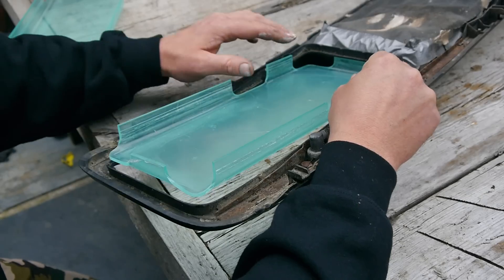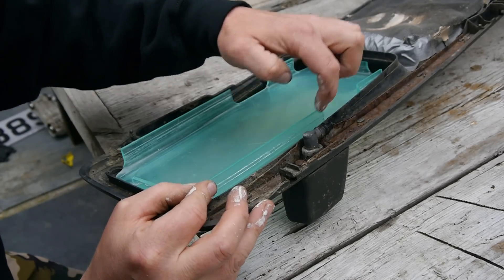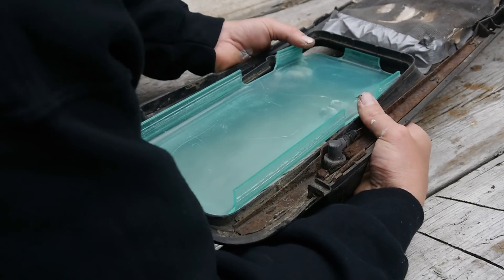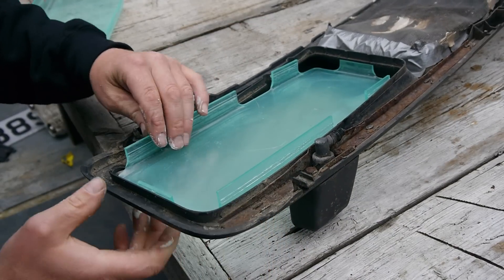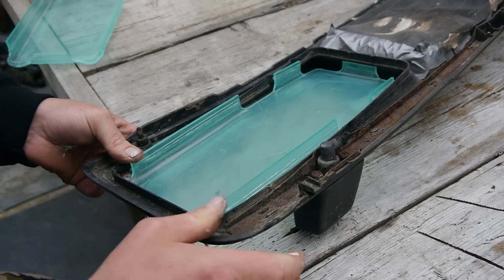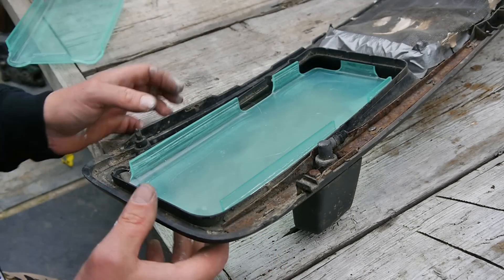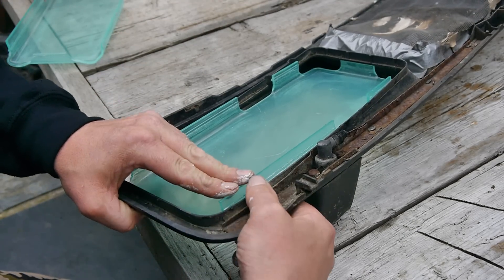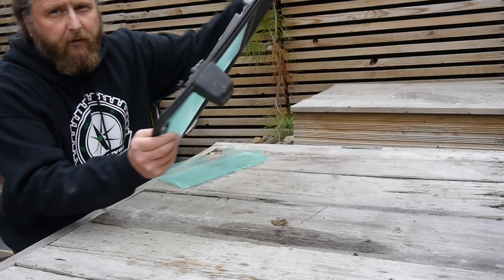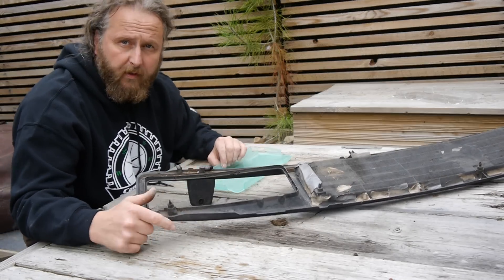Move it past the front lip, and then that will give you enough room at the back — just gently squeeze them in. You'll notice there's a lip on the edge that sits on the lip of the grille. Just squeeze the tabs in, go very carefully, and you'll find that they fit in with the little tab against the grille. Once that's done, just move it back slightly, then spin it round and do the same again for the other side.